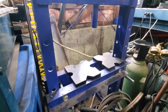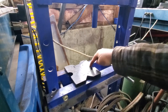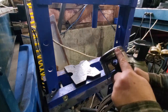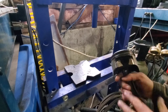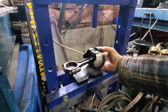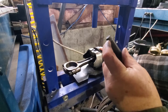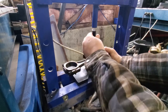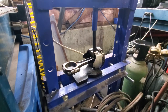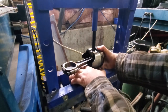I swear the hardest part is getting the camera set up. So all we're gonna do here is use the one plate with the round cutout — that's so the piston pin can go through that hole. The flat spots are going to support the flat sides on the piston. The tool is just a piece of steel that I had lathed out on the end so it's smaller — that sits right in the pin. The big thing is to make sure that the pin is not going to hit the plate — you'll feel it, it'll tighten right up. Put your hand underneath and you can feel whether or not the pin is going to clear the plate. If it isn't, just readjust it.